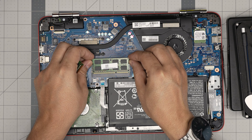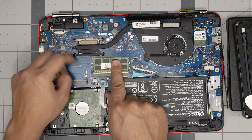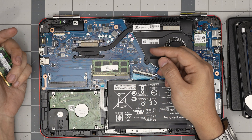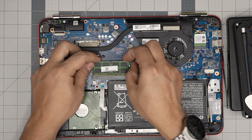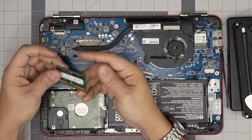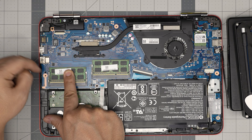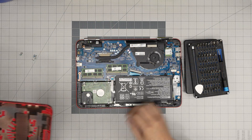If you don't push it all the way in, it won't seat properly — the triggers will open but it won't go in and you could damage the board. If you put it in sideways it won't work either, but you won't kill the motherboard or cause a short — it just won't boot. Make sure it goes all the way in. Same thing for the second slot: 45-degree angle into the connector, pinch it in nicely, and when you push it toward the board it should softly open and close.